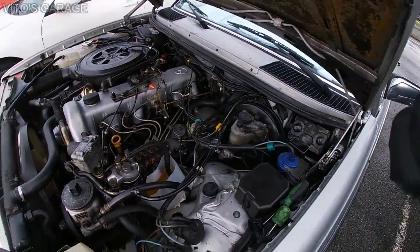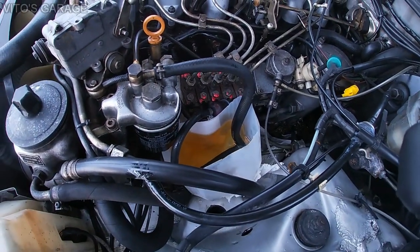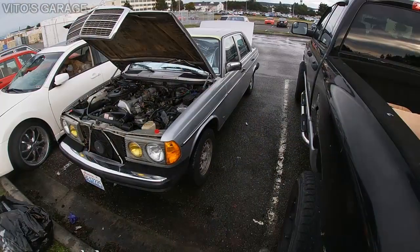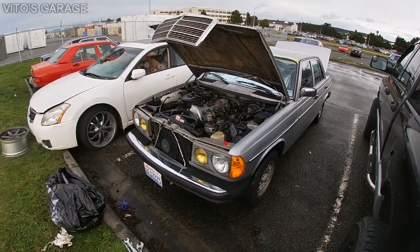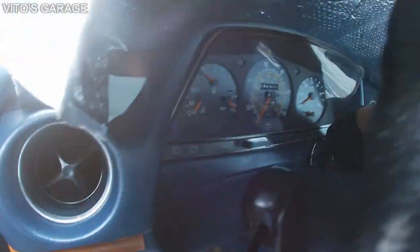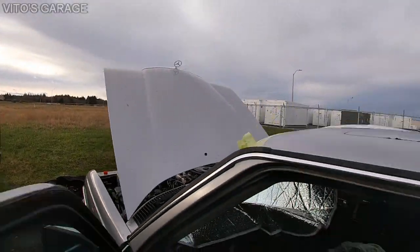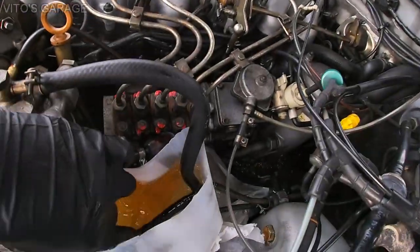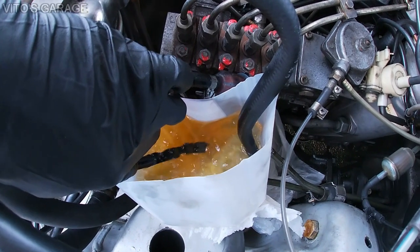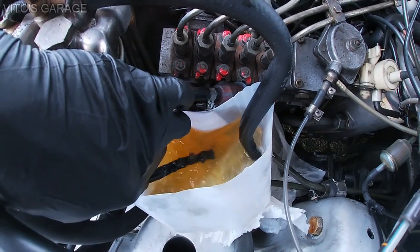As soon as I start it, I have to come here and watch these hoses, make sure these hoses are always submerged. That's very, very important, otherwise you're gonna draw air in. So anyways, let's go ahead and start this thing. Okay, start this up. The main thing you want to worry about is this feed hose right here. That always has to be submerged.